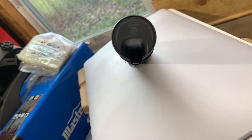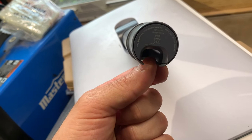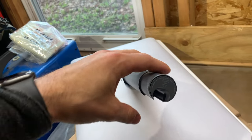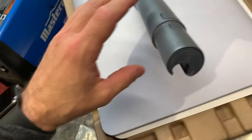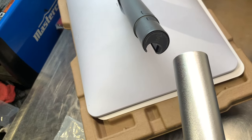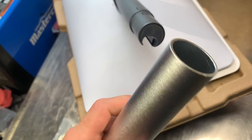As you can see, there's a keyhole slot that, if you buy the mounting kit, will slide right in there to prevent the whole antenna — the dish — from spinning. If you've got high winds or anything, this might move around and disturb your connection to the satellites. Along with the keyhole, you have this mechanism here that prevents the dish from disconnecting from the pole or falling out.